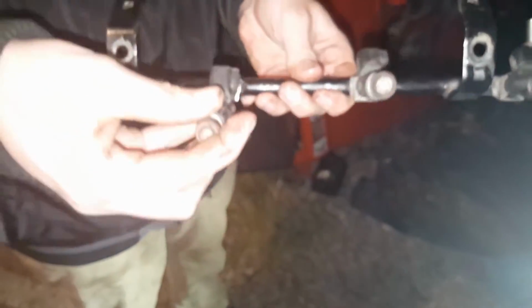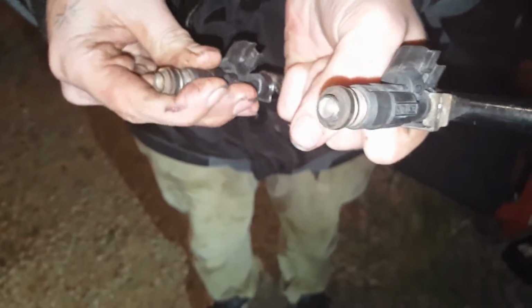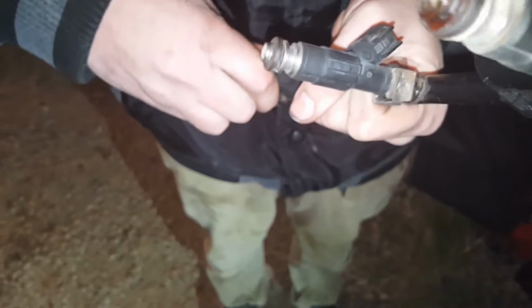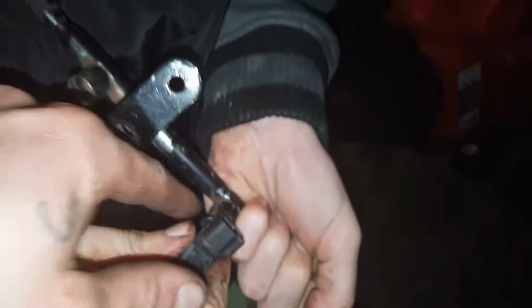So trade me the ratchet. So go ahead and stick both the injectors in there. Do it the same direction I did. So the plug, everything the same. Slide in there real slow and easy. Take your time. Twist a little bit as you put it in. Back and forth. Yep. You're getting it. Yeah, just line up that line. Right, that's good. See how the line lines up with the other? With the bottom up? You're gonna probably pull it down a little bit anyways when you put the clip on there. That's it. There you go.